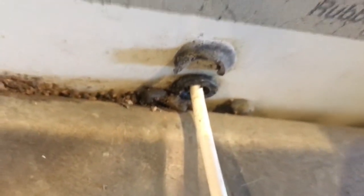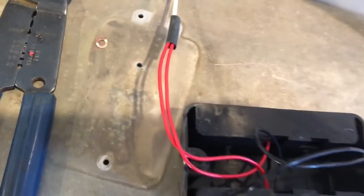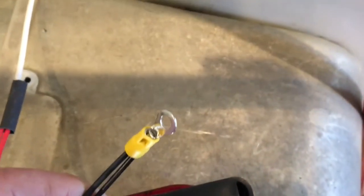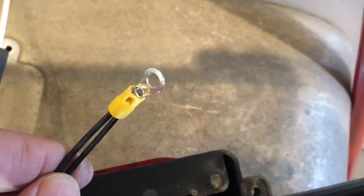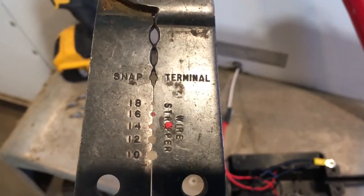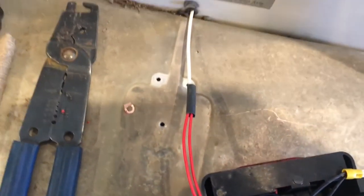It was nice — Hallmark went to the trouble of putting a grommet in there, and they actually used some sealant on top of that. Hopefully I can get that back on and reseal it with some silicone. I've got heat shrink pulled over here and I'll shrink that on — should be good. These wires are very, very small. I think I used the 16-gauge stripper, and maybe even 18 might have worked. It's not very big wire, kind of a pain to work with, but LEDs don't take much power. On to the next step.